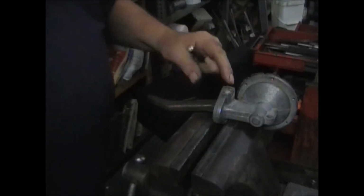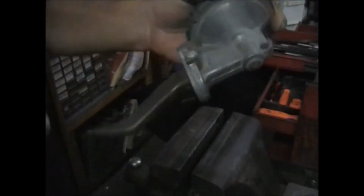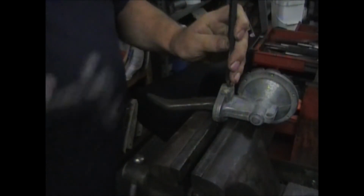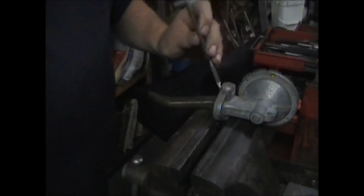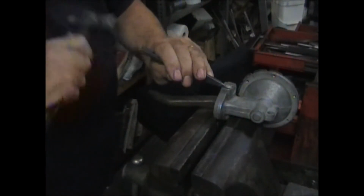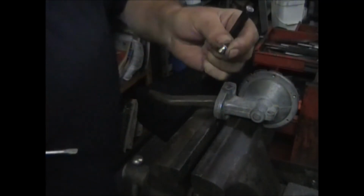We've got an aluminum plug here. There's a little piece of casting that covers, keeps the plug from dropping out. You're going to have to cut that off, and just get under the edge of that plug. Just keep tapping it back and forth. It'll work its way out. It'll get to a certain point and get underneath the edge of it. Lift it up. And the sole purpose of that is to keep the pin from sliding out.